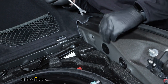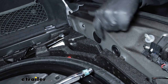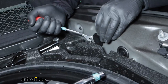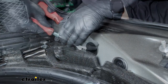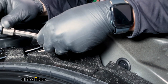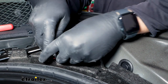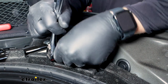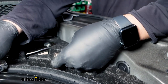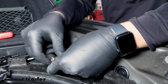On the back side of our skid plate here, we're going to have two grommets on either side. One of them is going to have a little dimple in the middle — you don't want to use that one. It's the larger one closer to the outside of the vehicle that you'll pop out and grab. Once you get that out, there's going to be a 10 millimeter nut back in there. Luckily we've got these little holes here we can look through. We'll take a 10 millimeter socket — I just taped the socket onto our extension so we don't lose it inside this cavity — and we're going to loosen that until we get the nut to the end of the bolt. Then we're going to have to stick a magnet in there in order to get it off.